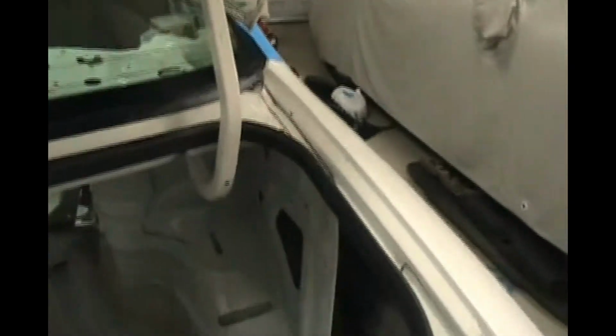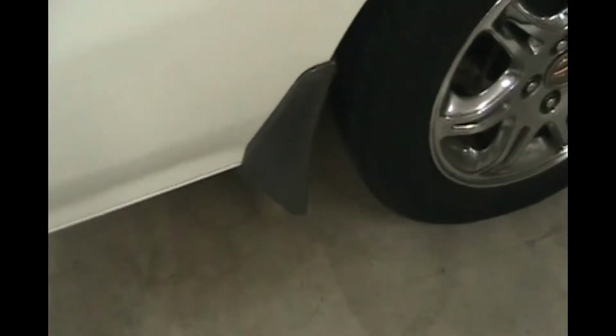And while that was coming in, I looked for more leaks. The first thing I did was check the sunroof. There are actually 4 drain holes in the sunroof, and they come out like, here's a drain hose where the jack is, and that water will drip out by the mud flap on the passenger and driver's side rear wheels. And then there are 2 other drain holes that come out by the front mud flaps. So in the sunroof, there are these drain holes in the 4 corners when you have it open. I poured water in there and the drains are all working good.